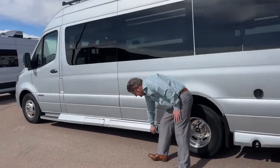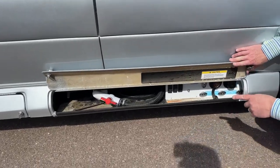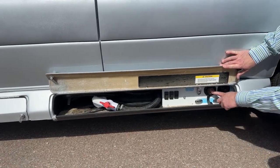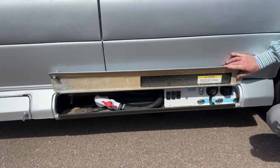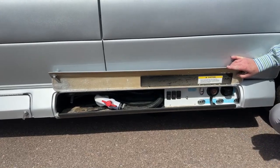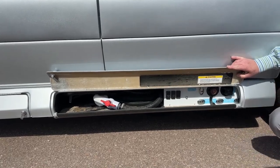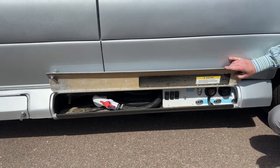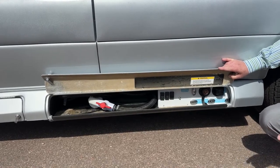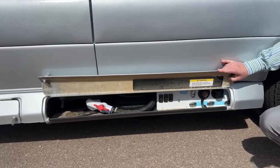Come along to the side here. Down in these little compartments is your pump station — you've got a macerator, a water pump, a drain pump, and your water valves. You've got your city water connection, so if you've got water pressure and a hose you connect it there. You also have a black water tank flush here — the nice thing is you don't have to get inside the toilet; it washes down the sensors right from here. Your fresh water is 25 gallons, gray water is 19 gallons, and black water is 9 gallons.